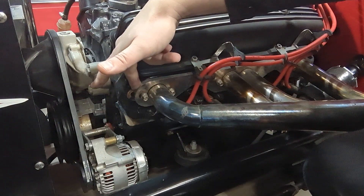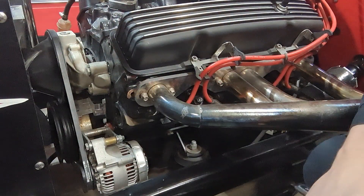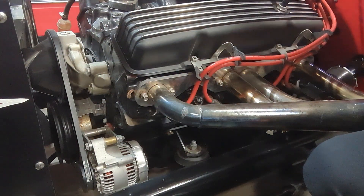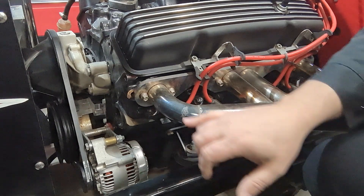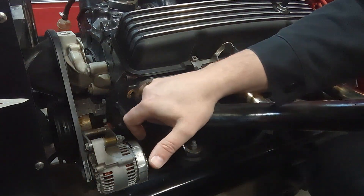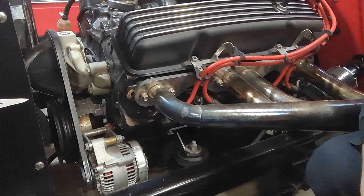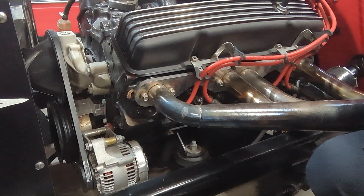We could blow this gasket out back here, or exhaust gas will be coming out this way. If you have a closed car and the hood is here, it's going back inside — so we don't want that. You just want to be as safe as possible. The Roadster has clips on here so the bolt can't back out — that's a safety feature that's worthwhile putting in.